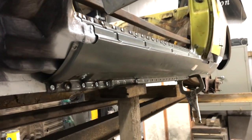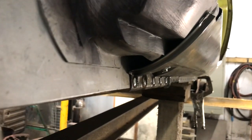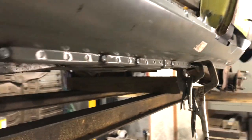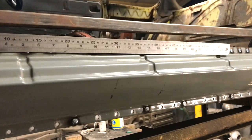Now here's something to pay attention to. Don't assume when you clamp the bottom edge of the sill it will remain straight, because it probably won't. Space the welds apart — not like how I started — and keep an eye on what it's doing as you clamp. It may not seem that important, but it is. Whenever the car is on a ramp you'll notice this, and it can look really bad.